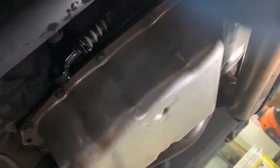back and forth. And then when you get to the end, same thing there, and then cross pattern, kind of like you would a tire, like the star pattern. But this is a little different because you're jumping back and forth kind of in that pattern. But all right, we're all torqued down to 80 inch pounds, and I got my block and my strap out